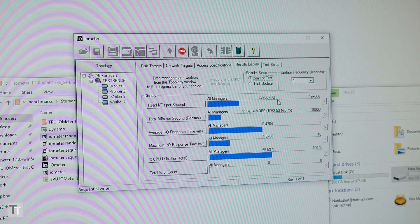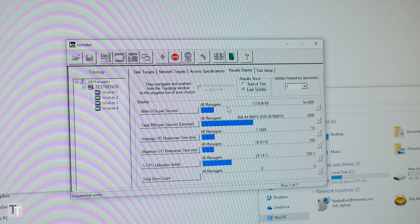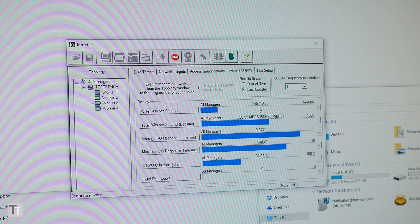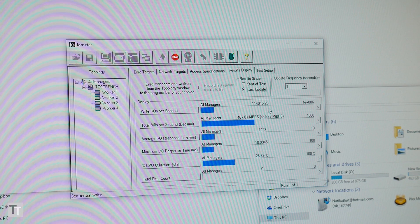However, when it comes to random read and write speeds, iometer shows Samsung's numbers are maybe a little generous. For sustained random read I recorded around 270,000 IOPS rather than the 330,000 Samsung claims. Meanwhile random write performance starts off matching the expected 330,000, but very quickly drops to around 100,000. They're still very impressive numbers overall, but there's a clear gulf between these drives and the Pro models.